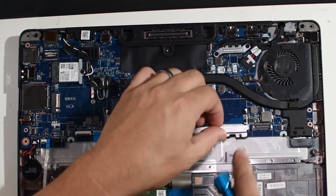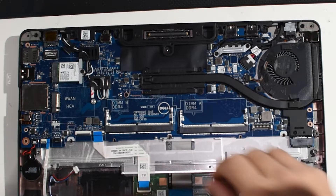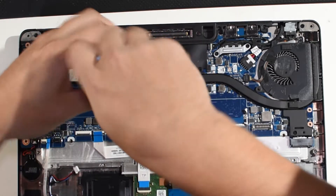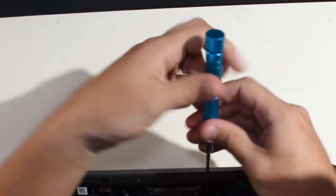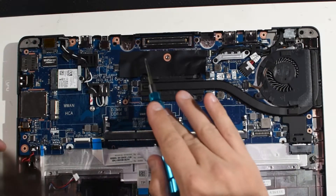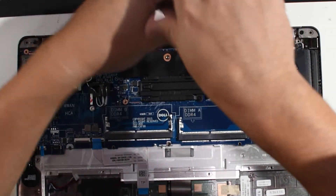That's actually just a shield — I can pull that off. Yeah, that's just a shield for the back area of the PCB here. There's also a screw here and a screw here that I'm going to pull out — they're both thicker and longer than the internal screws, so keep those aside and don't mix them in. After you've got that shield off, there's another M2 here and another M2 here, and those should be the last of them — also internal long screws.